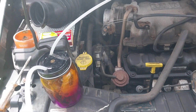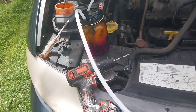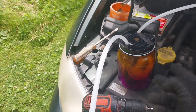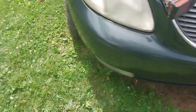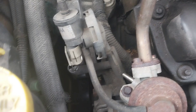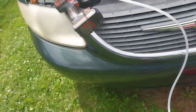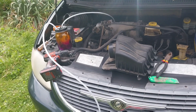This is my second time going through a mission — I've been dealing with this engine light for four years. But like I said, you can do your own little smoke machine with basic tools. This was under 10 bucks — three dollars for the jar, dollar 99 for the tubing, cardboard I already had in the back of the van. If you don't own a compressor, you can use an air pump, but you need a whole tire so you can cut off the stem, jam it in there, and tape it. I can see where it's leaking — we know what we got to change. Basic smoke machine under ten dollars. Hope you enjoyed this video, easy peasy!